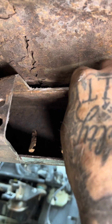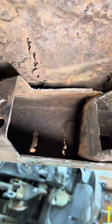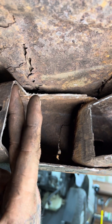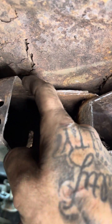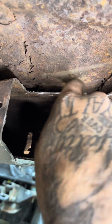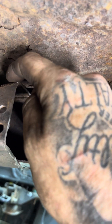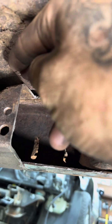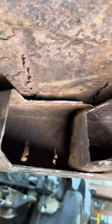This is the kind of repair I have to make here. I'll do my best to try to get some seam sealer after I put that up in there - put some seam sealer on the top side where it's not welded. If you turn your welder up hot enough and you bevel both sides and crank the welder up as you're welding and you're burning through - just like if I was burning from the top side down - it's going to close that gap up there. That weld is going to penetrate and seal that gap. But there's no way for me to treat it, so I'll try to get maybe a spatula or a paint stir stick with some seam sealer on it and just coat the top of that weld up there.